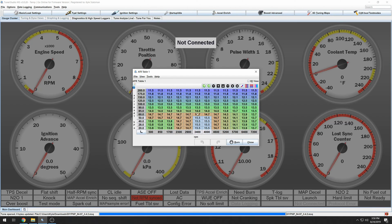As you creep up in RPM you want to start running richer, and as you go into boost or higher loads you want more fuel and therefore more rich. I'm going to leave all these targets alone to get you started. The only ones I'd probably ever change are making some of the low sections leaner and making the idle leaner for better fuel efficiency. But these should all be good, and you want them rich.